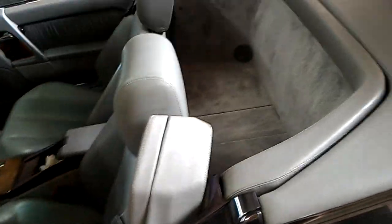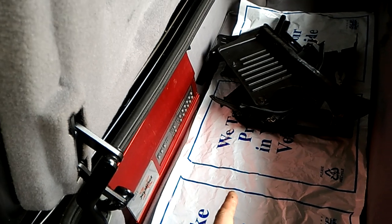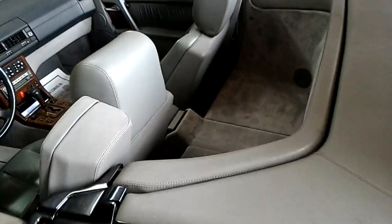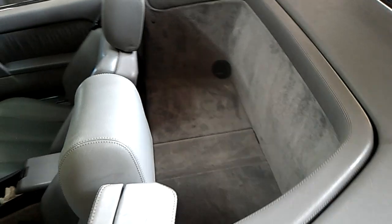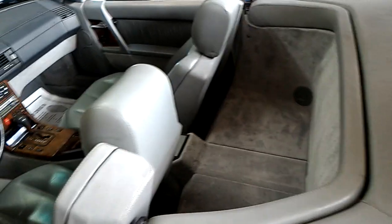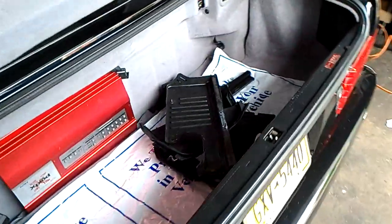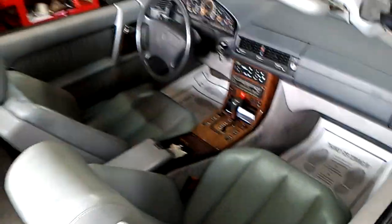The roof was an epic repair, but I did it. There were many issues. The first was the main pump — the return valve was blown, so I had to open the roll-up, get the return valve repaired, and put it all back together. Once pressure was up, the roll bar started to work, but the roof still hadn't worked. I opened up the whole paneling, double-checked all the solenoids, and cleaned up some rotted connectors. You can't read the codes with a regular computer — you have to use the blink tool — so I found all the codes and cleared them.